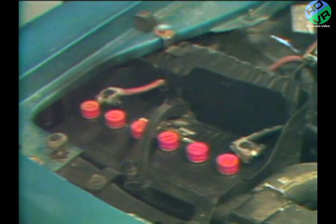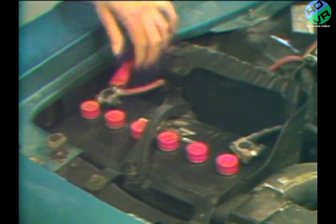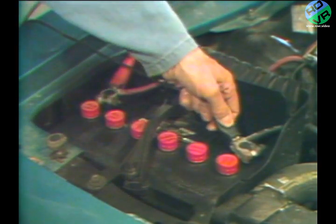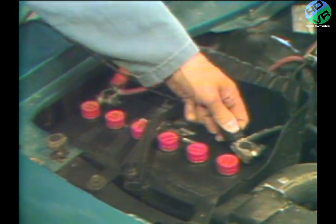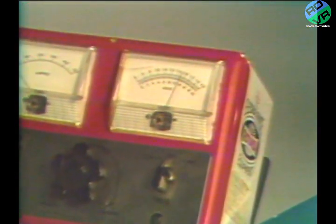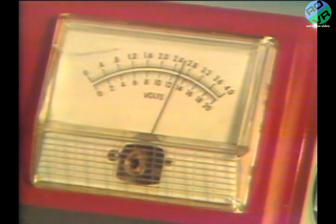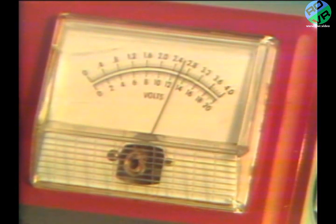Connect a voltmeter across the battery where it will remain throughout the three-point test. Make sure that the meter jaws or probes get a good bite on the battery terminals and observe polarity. That is, if the meter reads downscale, reverse the leads. Take a meter reading and record it. In this case, we read 12.8 volts. This is our base voltage, and remember that it was taken with the engine not running and no load on the system.